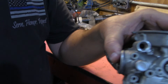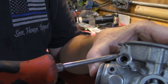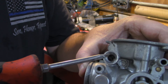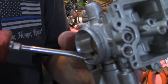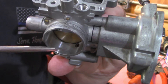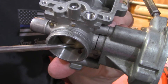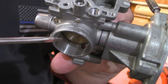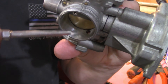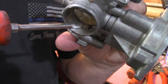Now this is going to be a little difficult to see because it's so far down in there, but if you look down in this hole, you can see the hole — that's where that alignment pin or guide pin goes through, and the sealing surface is on the outside of that. That's where the mixture goes once the valve opens, coming through this hole right here behind the throttle blade. This side is super high vacuum because it's on the engine side of the throttle blade when it's closed. That's why you don't normally want to apply the throttle when you're trying to start one with the mixture enrichener, because it prevents the enrichener from working — your vacuum will suddenly drop. So normally, if they're tuned correctly, you can cold start without hitting the throttle.